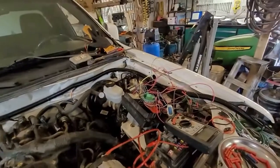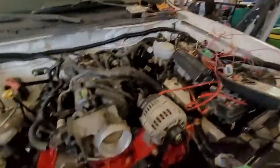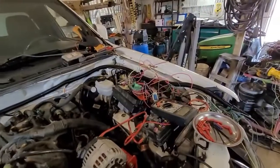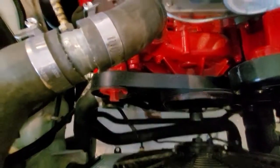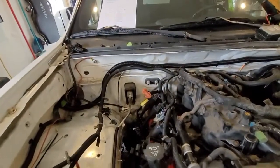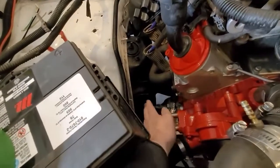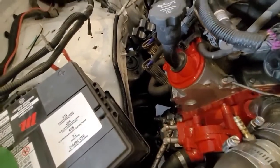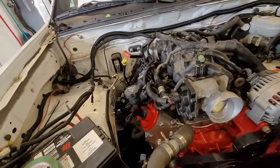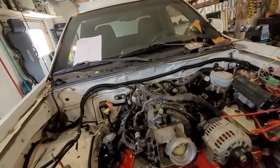I just wanted to see if it would kick and run — usually it'll only run for about two seconds and then shut down if the VATS aren't turned off. It's not firing and I'm not exactly sure why yet. No doubt I missed something in the wiring, but I will get that sorted out. Before I do any more wiring, I'm going to get those tranny lines hooked up, and I may as well hook up those lines to my heater core while I'm at it. I think then we should be okay to try and start it.